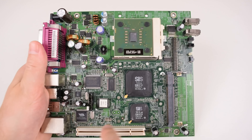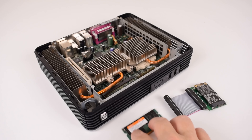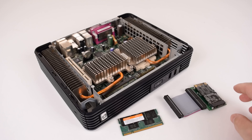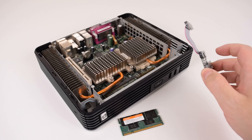We've had a look inside the machine. Now I'm going to install Windows XP, benchmark the integrated graphics as well as a GeForce 6200, then check out Windows 98 and MS-DOS. For Windows XP I'm going with a 1 GB RAM module to help with performance, and for storage we're using a 64 GB mSATA SSD together with an mSATA-to-IDE adapter.